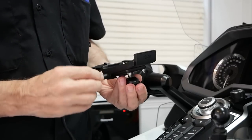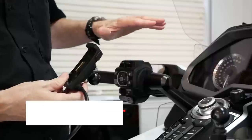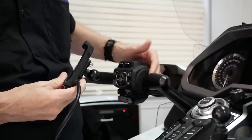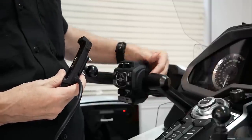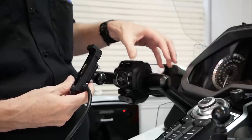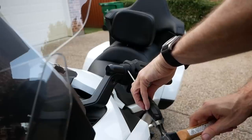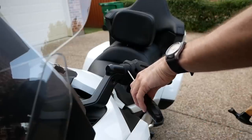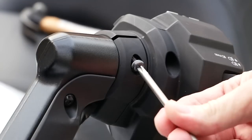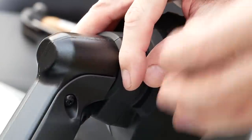What we have here is the cradle for the Zumo 590, and my objective is to mount this on the left side of the handlebar. I've gone ahead and removed this little trim piece here — there's just one screw holding it together. The trim ring is held in place with a single screw. I like to give it a firm tap with a hammer and a Phillips screwdriver and then the screw usually comes out pretty easily. Once you remove this screw, the trim ring just comes apart and what you're left with is a nice round handlebar that you can mount to.